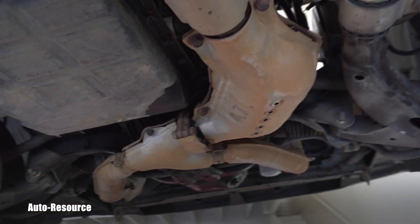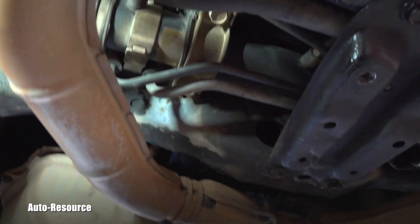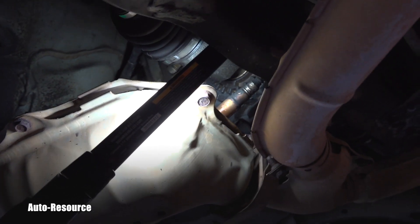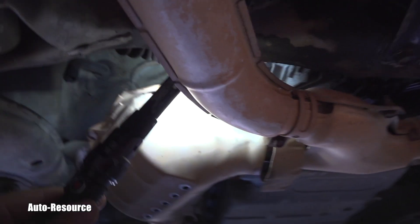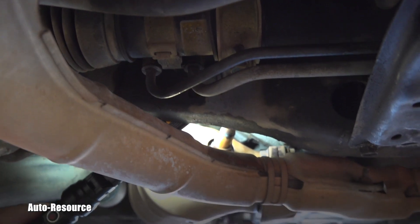We have to move a little bit forward. I'll follow that exhaust system to find the other sensor. Let me bring the light — hopefully it will help. There we go. Look over there — I know there's not much space for the camera, but do you see that thing sticking out with the electric connector? That is B1 S1, bank 1 sensor 1. The computer tells us there are problems with this unit. You can see it right there at the thread.